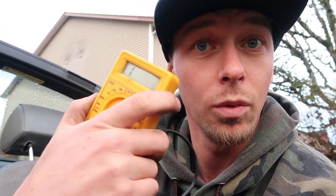the OBD, and gone ahead and taken apart all the K-Line connectors and I found the one that's to ground. You just hook something to ground on your ohmmeter and you'll find out which one is grounding if you have a grounding issue. So I've done that, isolated the line that I've had problems with, and I've used my scanner to scan and figure out what modules I actually have.